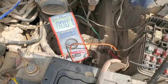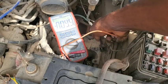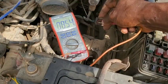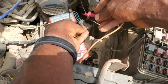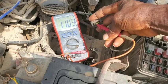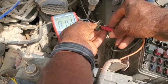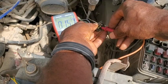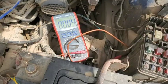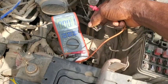With the ignition on — I have the fuel pump bypassed with direct power so the fuel is running. Testing the blue wire: we're getting 8.5 volts. Testing the green wire: 11 volts — that's supposed to be the 12-volt supply. On the middle signal wire: 0.15 millivolts — practically zero. So we have 11 volts from the green, 8.5 volts from the blue, and no signal reference voltage on the middle wire.